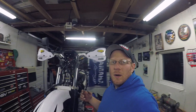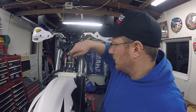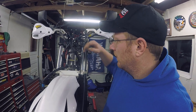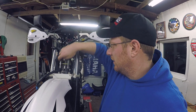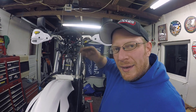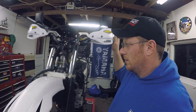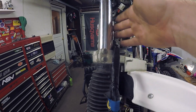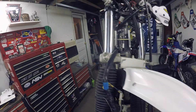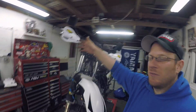I've got both mounts fitted now with a bolt between them squeezing them together since I don't have the through-bolt in the middle yet. With the spacers in there, the mounts are clamping on the side of the tube — I'll put a little piece of 3M sticky rubber in there to prevent chafing and absorb some vibration. Both mounts are parallel. I have to bolt to the inside because bolting to the outside would hit the fork tubes, and I want to keep as much turning radius as I can.